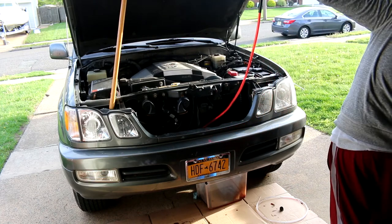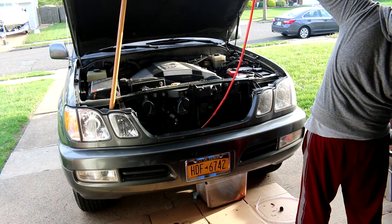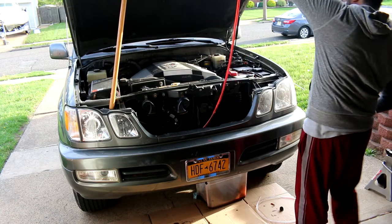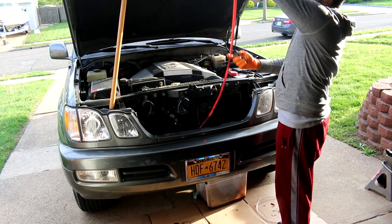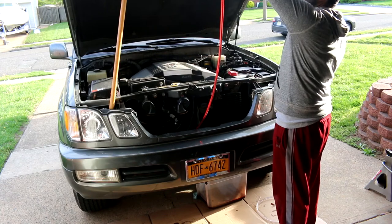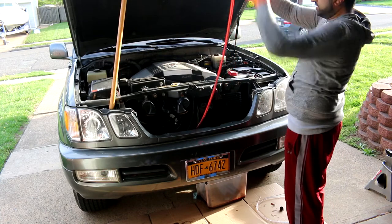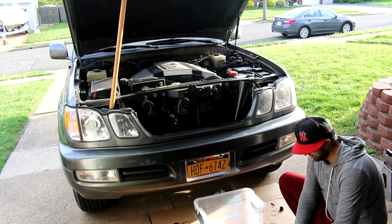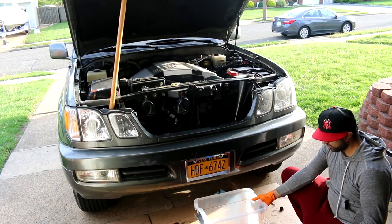What I'm trying to do is get rid of all the old stuff before I start putting the new stuff in. I don't see any leaks anywhere so it's definitely going back to the transmission — I don't have the wrong line. I'm going to keep going and start it up again. The return line actually goes right back to the transmission pan, so it's the same thing as filling it from over there. But it's working and it's actually easier than trying to do it from the dipstick right now.